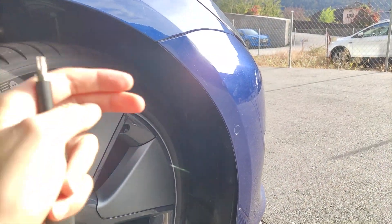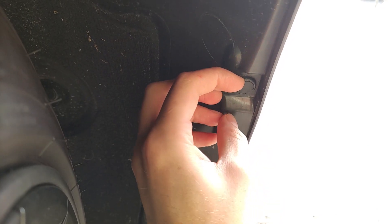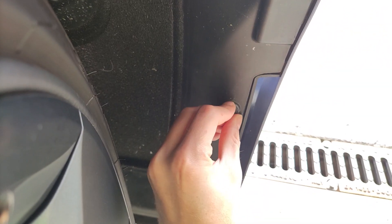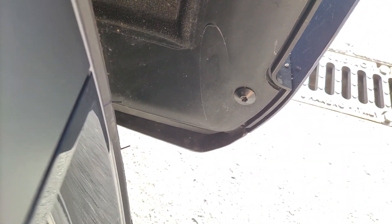So if you want to open up the side panel, go to the front right side of the car. There are going to be one, two, and three pins that you have to unplug. You can use a flathead screwdriver or even just your finger and pull. The third one requires a Torx screwdriver.